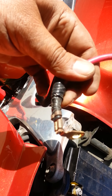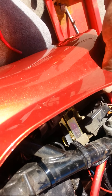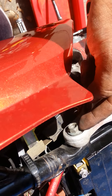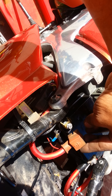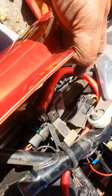This is the contact point that connects to the starter relay — that little box down there. Bringing it up into the sunlight. Because it was so small and tight I probably could have gotten away with using it too, but it was comparable to the fancier, newer contacts. So I wired that and it just tucks under here, comes back this way, and then loops again.